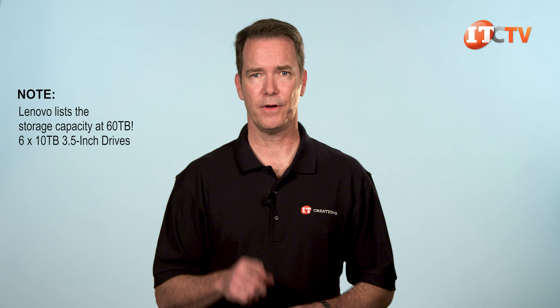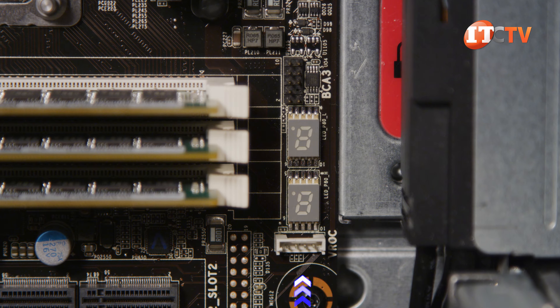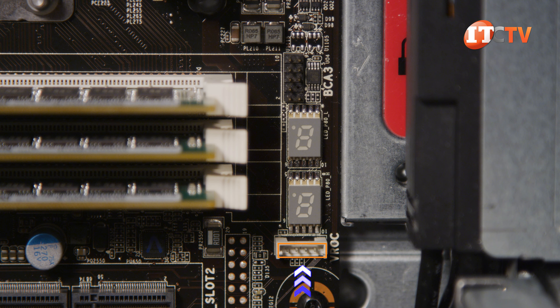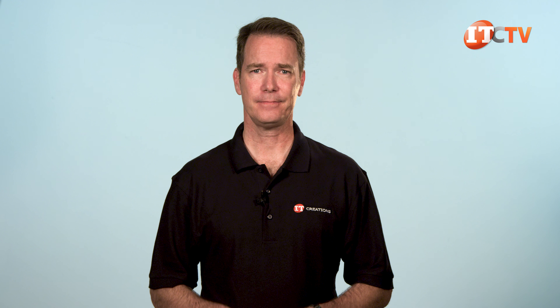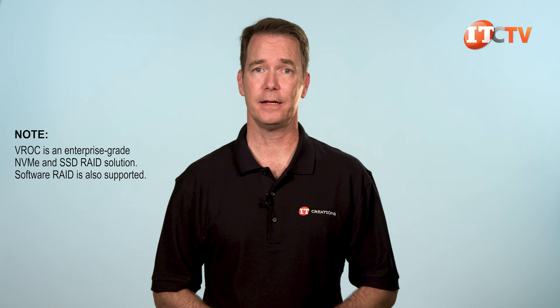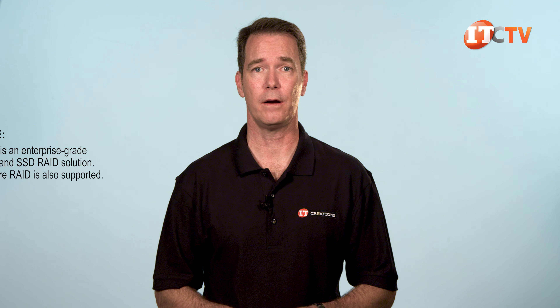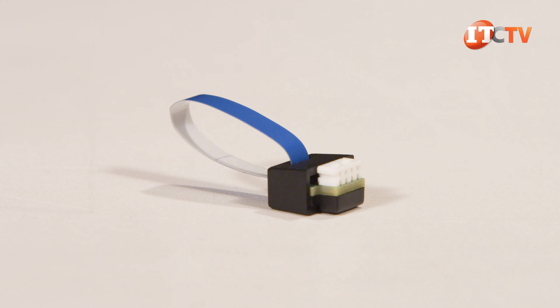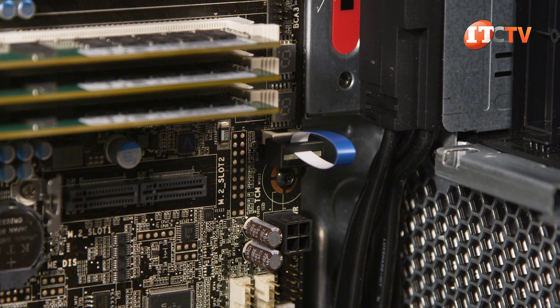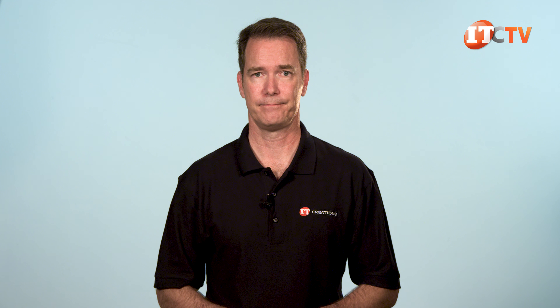The two onboard M.2 drives and the M.2 PCI quad drive card can all be RAID-ed, but require an NVMe RAID upgrade in the form of VROC or a discrete HBA controller. Intel Virtual RAID on CPU, or VROC, allows you to connect NVMe-based SSDs like M.2 directly to the PCI lanes supported by the scalable processors — no HBA controller required — although you will need an optional VROC activation key available in basic or premium versions. Basic provides RAID 0, 1, and 10; premium adds RAID 5. VROC is not hardware or software RAID but a hybrid RAID technology.